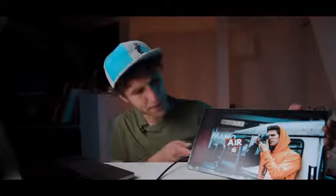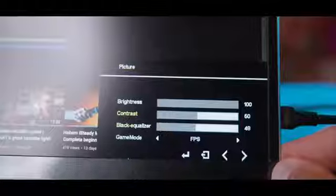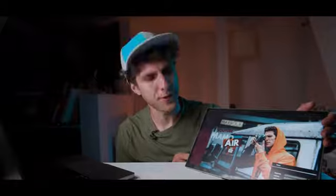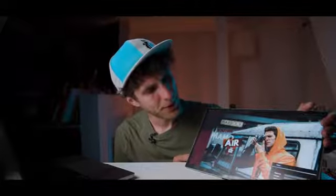A couple of things I noticed when I first tried it: the monitor didn't look bright at all, but that's because you need to go into the settings menu. Press the settings button on the side — you can also adjust speaker volume there — then under Picture Mode, go to Game Mode, select FPS at the bottom of the menu, and the brightness changes noticeably. It was in the wrong mode by default, and FPS looks best for my needs.